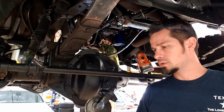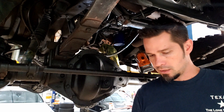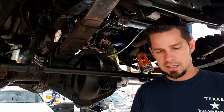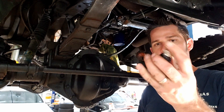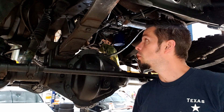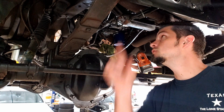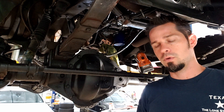Okay, time to finish up the Blazer. We got the mechanical fuel pump off — that was a royal pain — but it's unused so it's off. We're going to replace it with just the standard small block Chevy fuel pump cover. Then to replace the cheesy heater hose going into the pan, we have some 500-degree braided steel line and an AN10 fitting with a through-pan bulkhead bolt that we're going to install into the oil pan. I was going to try one of the return fittings that drops oil through a plate, but because of the turbo placement and the exhaust manifold right next to it, the turn was too tight — it would have had to go down and then back up, and since it's a gravity-draining turbo, that wouldn't have worked.